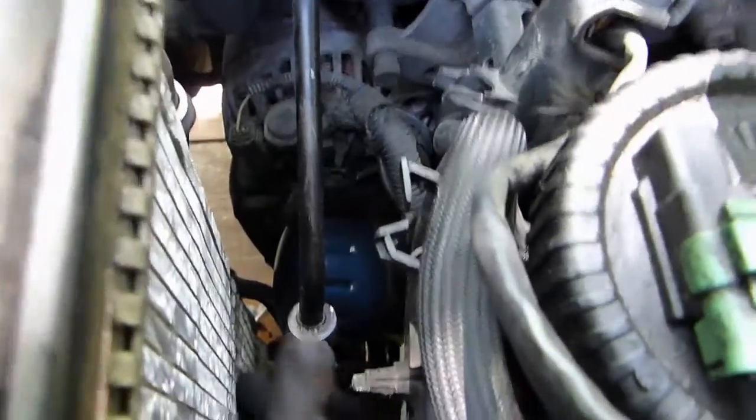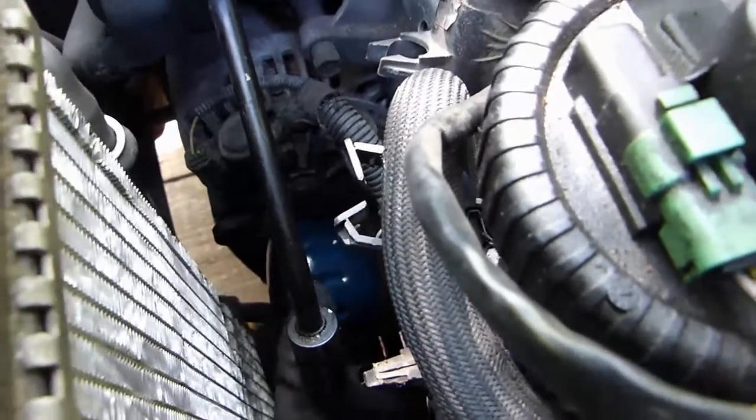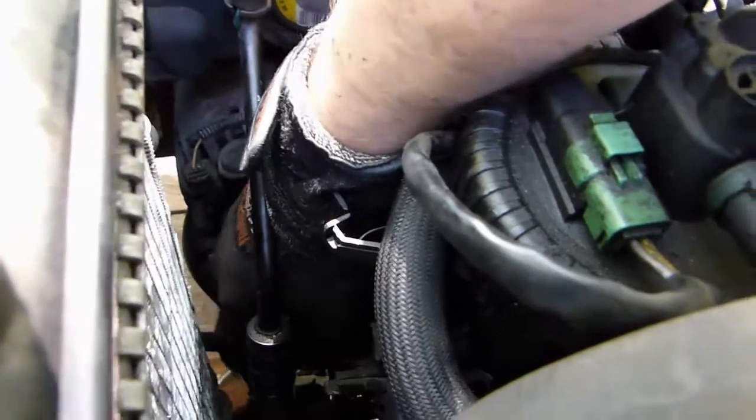Okay, so I'm gonna put it back by here. I need my 2 hands. Once you've started screwing the filter on, then just keep screwing it on as much as you can by hand. When the joint comes in contact with the metal, you're gonna feel it. When it becomes too hard by hand, put the key back on and do 3/4 of a turn. That's what it says on the box. You can do that. Okay, so it's easy to do by hand, like that. Make sure you can't tighten any further by hand before you start using the key.